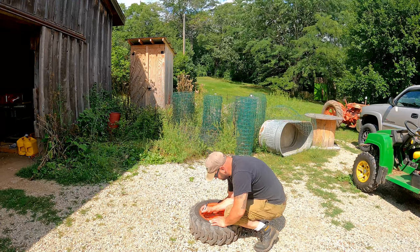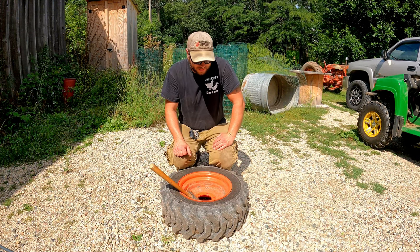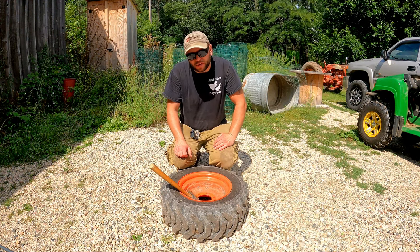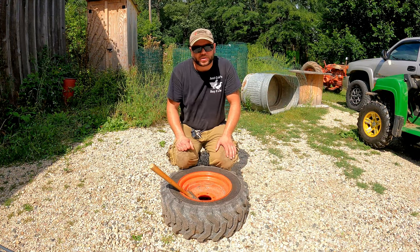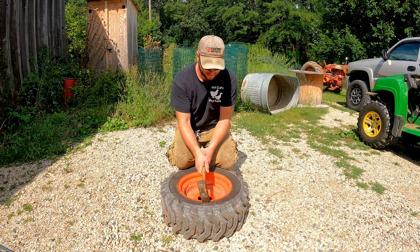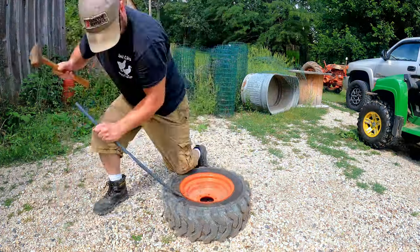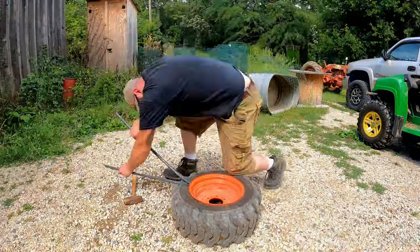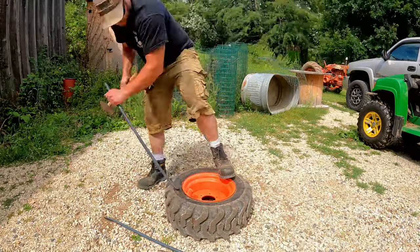I'm marking the rotation of the tire on the rim so I know how it goes back together once I take it apart. The first thing I need to do is pop the bead off the rim so I can get this tire off, and I have a confession — I don't know if I've ever done it with tire spoons. I've done tires with tire machines in the past, had a job at a tire warehouse in high school, but I'm not sure I've ever done one by hand. So we're going to try to pop the bead. The hammer did not work very well and neither did using the tire spoons. I struggled with it quite a bit but persevered and got the beads popped. I did find a better way to do it — you'll see that later in the video.